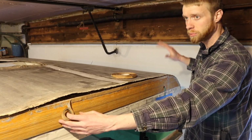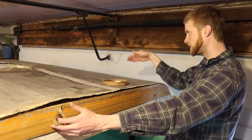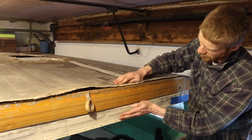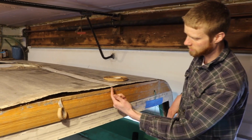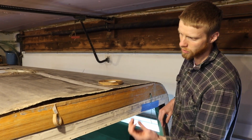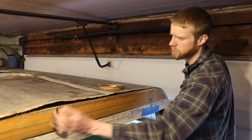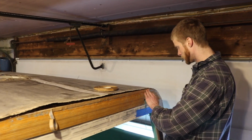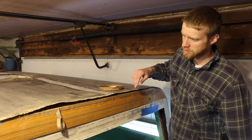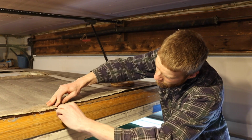We have the roof on in place. We stapled the front. We pinned it at the location in this situation. The roof is designed to get peened over and overhang the edge, and then we're putting the butyl tape on, which is 5/16 wide, I don't know. We're using the thinner width butyl tape for this because it only is overhanging a little bit, and then it kind of isn't perfect. So that's what we're doing right now, just putting this butyl tape on until it gets to the point where we're going to need a little bit wider butyl tape.